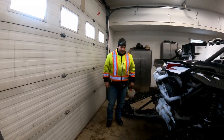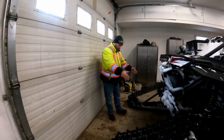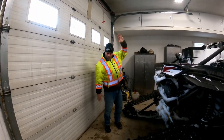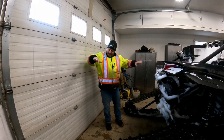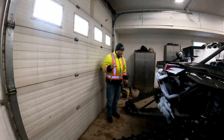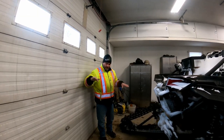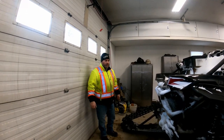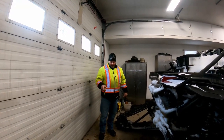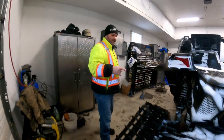What I see most often on these is those long arms in the back. If you're going to beat it, go full pin, and then you hit a hole and a whoop and one track hits and bottoms out, you'll bend the ends. So take it easy over bumps — in big soft powder you're okay, but on hard pack in the trails if you hit a big whoop you might end up with a bent arm.